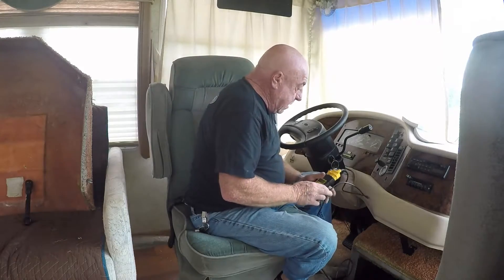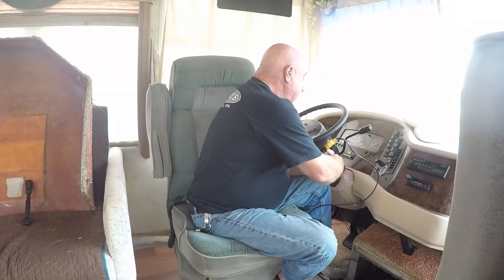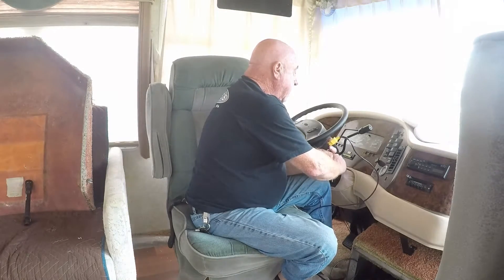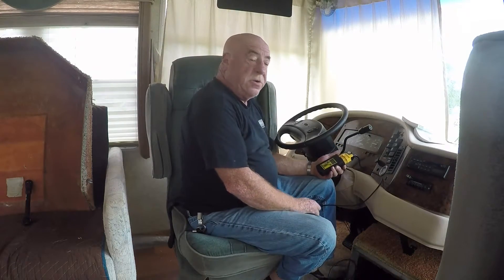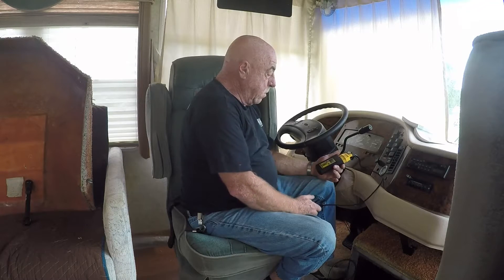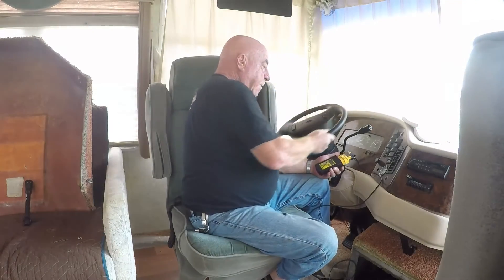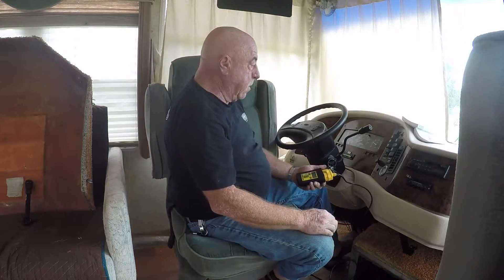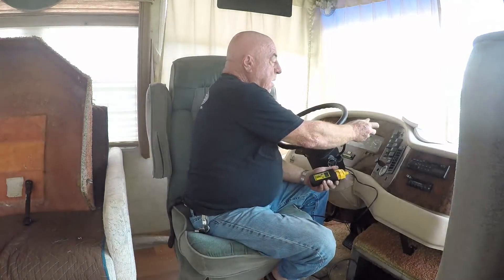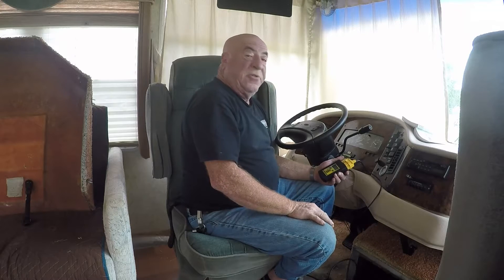Alright, wires are out of the way, scanner's off. Turn the engine on, then turn the scanner on — you'll hear the engine start to rev. I'll work through the brake pedal and overdrive until it gives us a code 10, which means I have to press the accelerator.